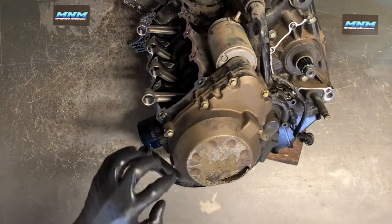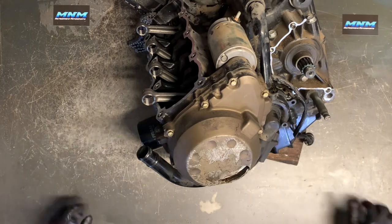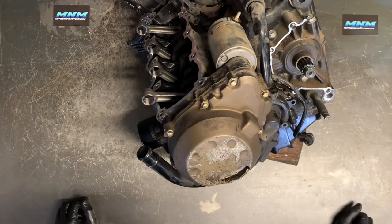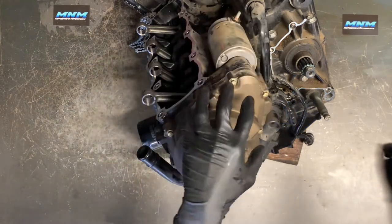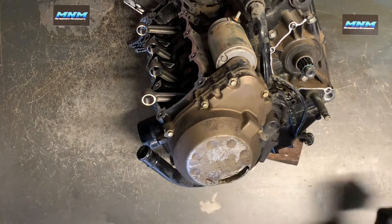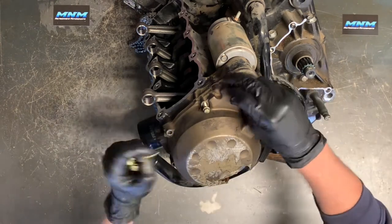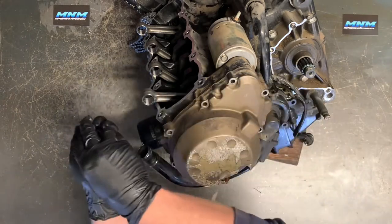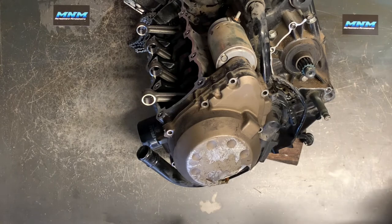The charging system — the generator, alternator, stator, magneto, flywheel, starter drive — that whole assembly is what we're getting into today. We've got eight millimeter bolts around this cover and a starter we're going to pull off. We're going to start by removing all of the eight millimeters around this stator cover. We've got all of those off — they appear to all be the exact same size, no need to worry about order.